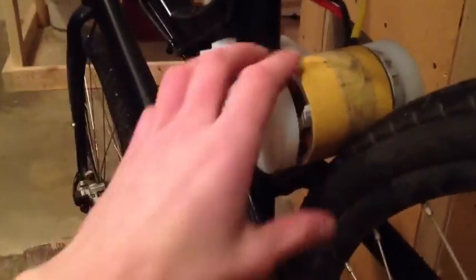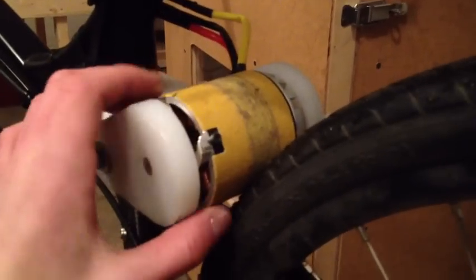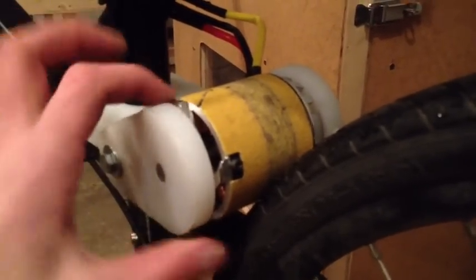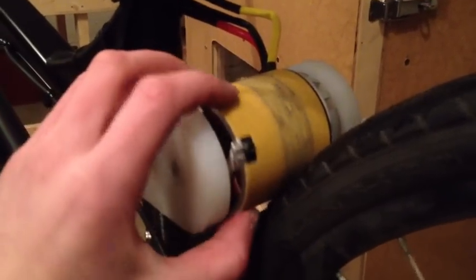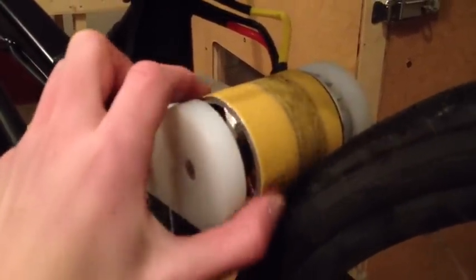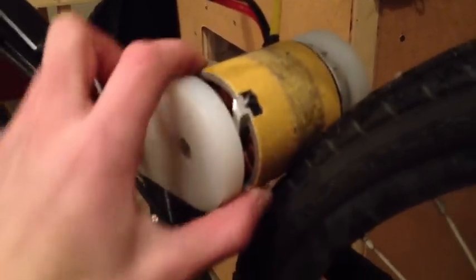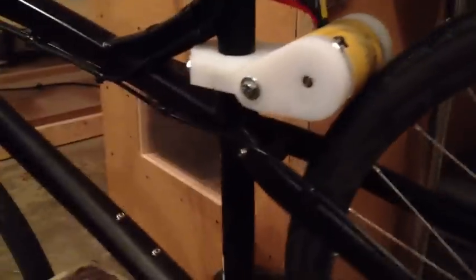This whole unit can spin on the back side. It's bolted so one side is held, and then the shaft is supported so the can can spin against the wheel. I had a problem with this unscrewing during braking — this flange is screwed into the can of the unit — so I drilled and put a set screw in to keep it from turning loose. I imagine I could have found a more creative solution but it worked just fine. I just had that one in the garage so it was simple.